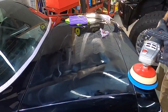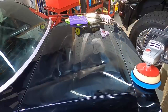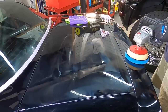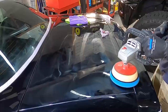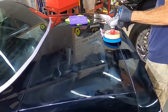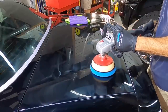To finish, I don't use a lot of pressure — I just like to guide the polisher back and forth. With a finishing polish and finishing foam pads it's not quite as critical, and you can actually turn up the speed on the polisher. For finishing, I have mine on the fourth speed — maybe a tick above — which is a little bit higher than I normally use the machine, but for finishing it really gives me the results I'm looking for. That said, it's subjective to what you're working on, the conditions, and what you prefer.